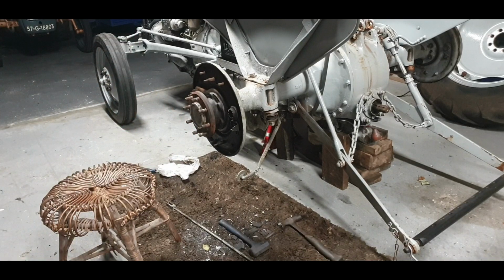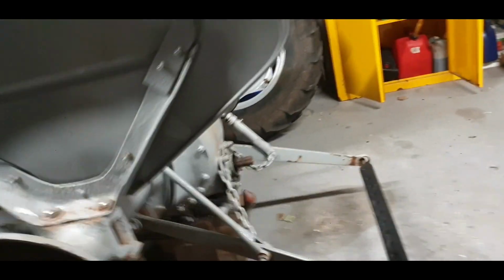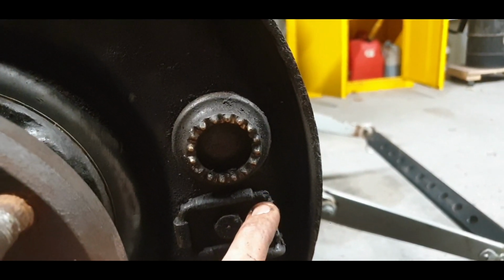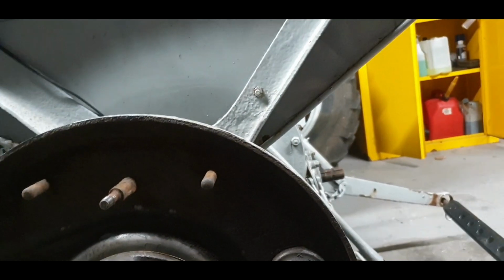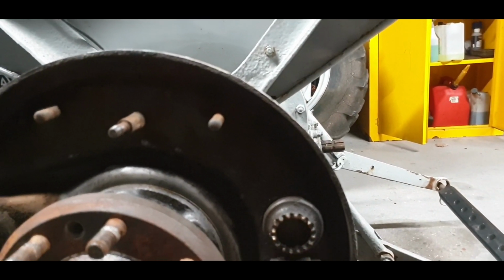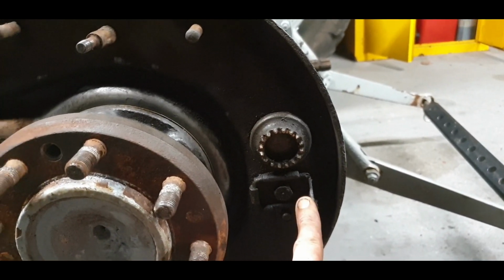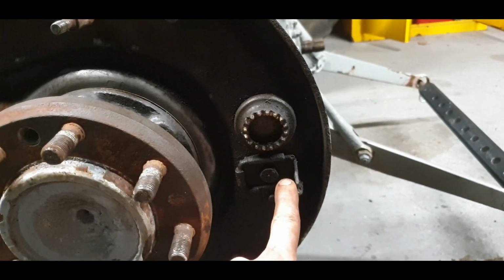Okay, so the next job that I'm going to have to do, apart from putting in that brake on, is I've ordered two of these brake adjuster backing plates, because it's got the bottom piece there, it's meant to have the top piece broke off up there. So I've ordered two of them because the one has gone on the other side and I'm not happy with those brakes. I've adjusted right off and they're still fairly stiff to turn, so when I took the wheel off, I'm going to have another look in there. I'm going to replace these on both sides. I thought these were a different part, but now I realise they're not. It's been a while since I looked in there. I usually do have to replace these.